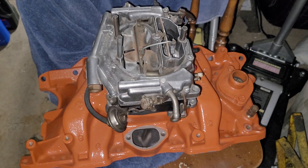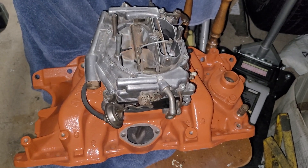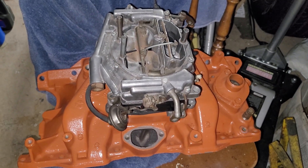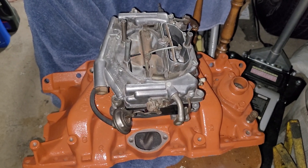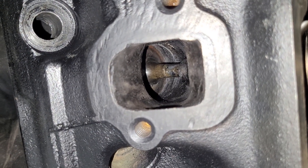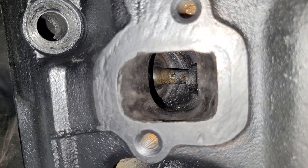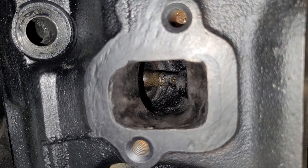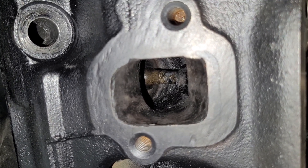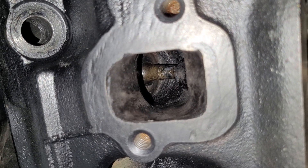Just a teaser — it's on an old chair with a towel under it; it's so pretty. We're going to do some flow test action on that and see where that leads us. Look at the Magnum head — notice how much smaller that exhaust port is and it's shaped so much better. I bet the chamber and the intake port are way better too. Looking forward to doing this — can't thank my friend Rob enough. Thanks a lot guys, have a good night.